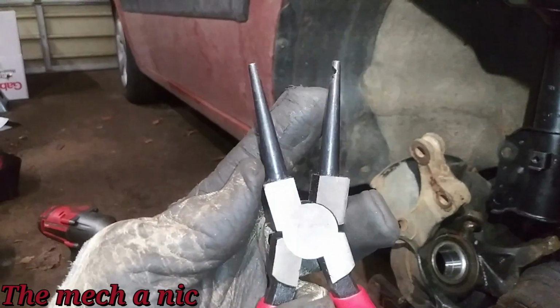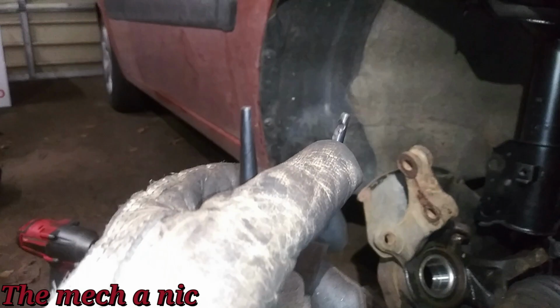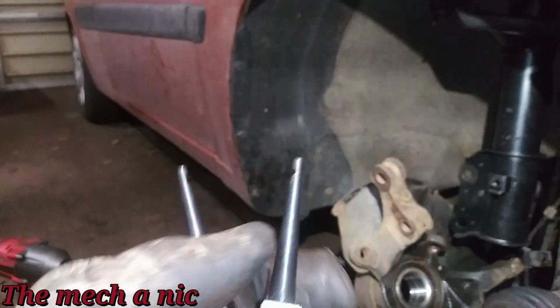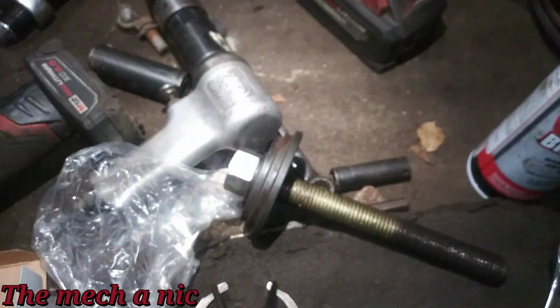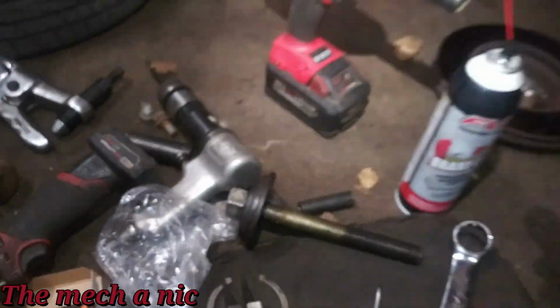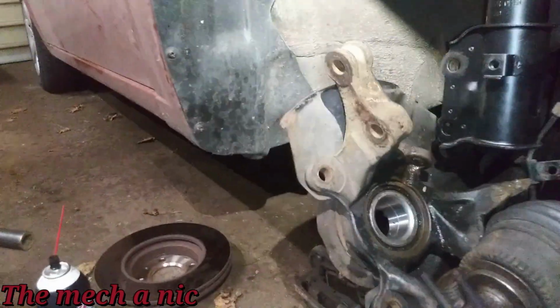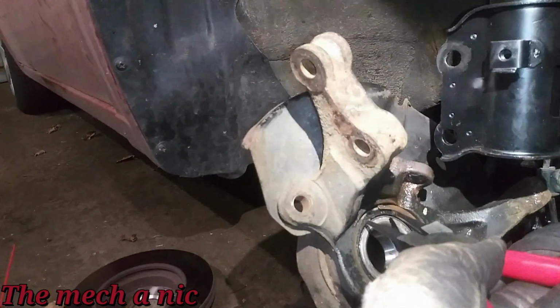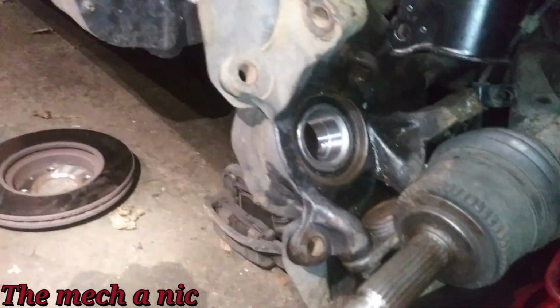At that point, it's useless having one prong on it, so I snapped the other one off as well. And then I cut some grooves in right there and right there. Now that actually holds on to these types of springs or retainer clips way better. It's way less likely to pop off, and this modified tool right here was the only way I was able to get in this original retainer clip, and it worked great the very first try.